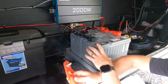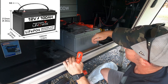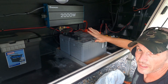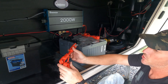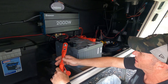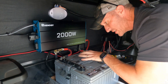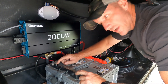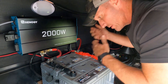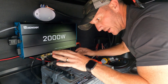These should go in exactly the same way. Dimension-wise, the Uniwix are a little bit narrower, so I may have to move my brackets a little bit so they fit nice and snug. But as far as fitment goes, they're going to go right back in place with no issues. These are two-gauge jumpers, so they're going to carry that current just fine. Another nice thing about this style jumper is if you have to replace a battery, you can just unbolt the jumper and you don't have to take all your connections loose — just take the jumper loose, move the batteries, put new batteries in, hook the jumpers back, and you're not messing with all your main battery connections.